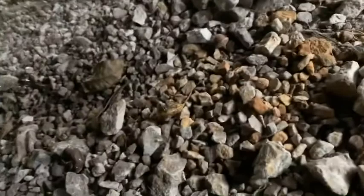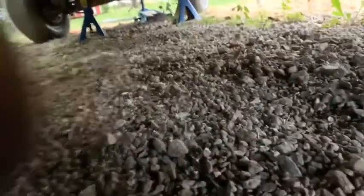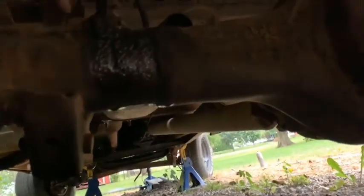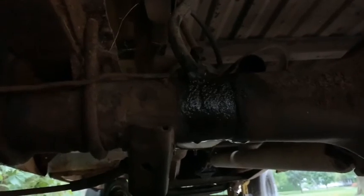So let's check out the rears. Now the rears, I took the line off last time. So honestly, we should just be getting brake fluid to maybe here, and definitely to here, which I can see it leaking because I took this other brake line off. I'm gonna reattach it, make sure it squirts out the other side, and then I'll probably reattach these and see if they squirt out the rear wheel cylinders.